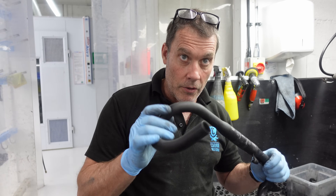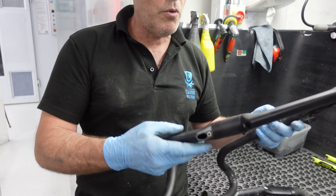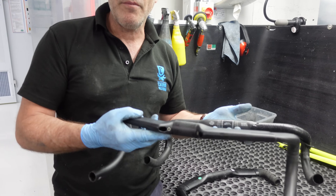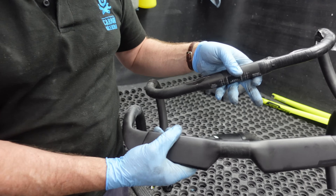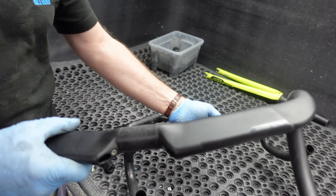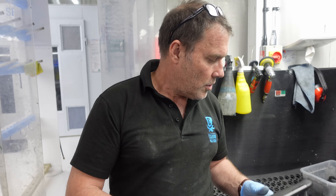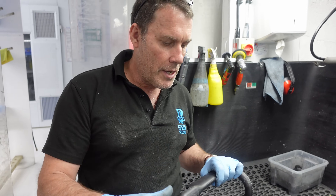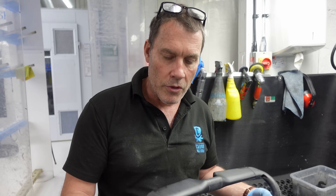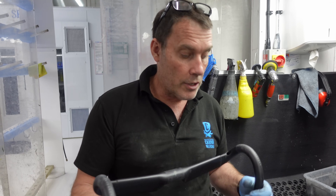There's not a lot of material on this shape, whereas with this aero bar there's quite a lot more material — comparable in weight, probably the same if not slightly lighter. It's quite a big difference. The joy of working with carbon fiber on things like bars is the ability to produce as many shapes as you want — for aerodynamics, ergonomics, comfort, ride quality — whatever you want. There are far more options available in mold-making than in extruding aluminium bar.